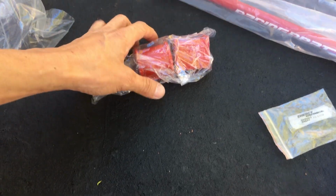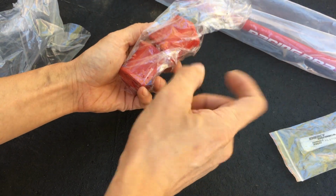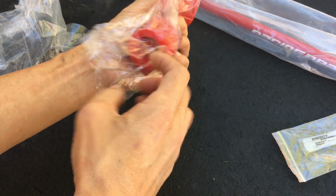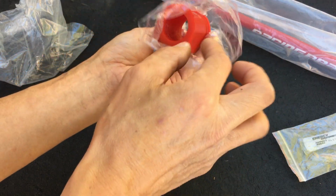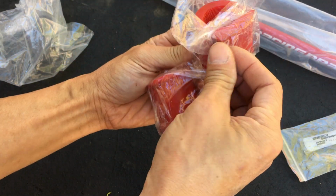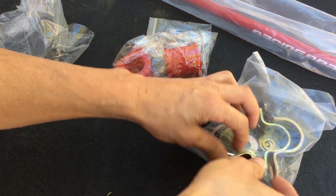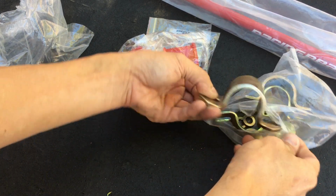Well, actually, I shouldn't say they're good because of my screw up. The top bolt where the bushing is has really tight space. So I used the wrong wrench, and I actually got the wrench stuck, so I had to cut it off. I used a plasma cutter to cut it off, so it got a little bit hot on the bushings, where the bracket meets the bushing. That's the front right here.